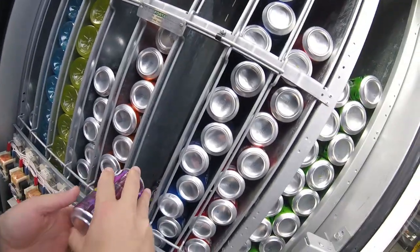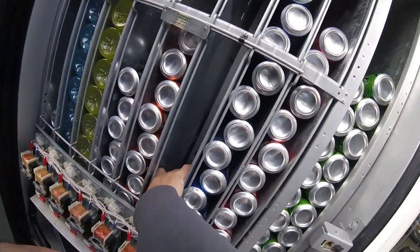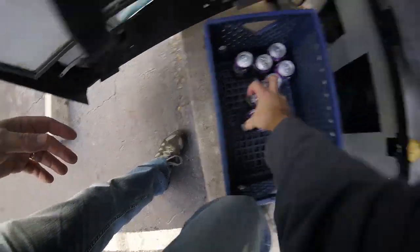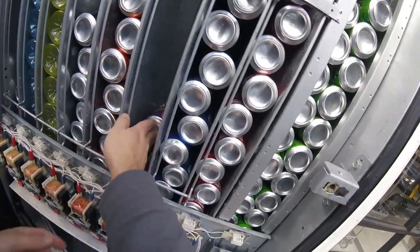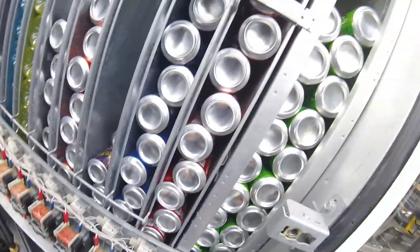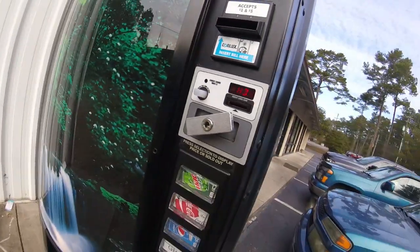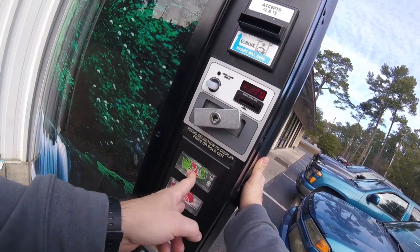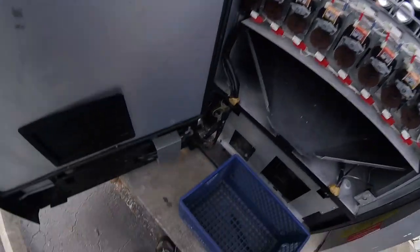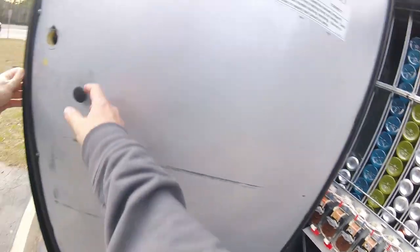What I'm questioning now is that JC10 error. This is a Dixie Narco 501e — it's only got nine columns, so what could column 10 be erroring? I've done a little research and read some online forums, and some people seem to think that when you see a JC10 error on a Dixie Narco 501e with only nine columns, there could be a programming error where the machine thinks there's a 10th column. I've never had this issue with a flashing decimal point before.